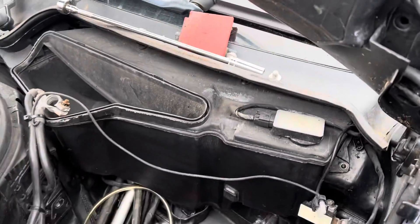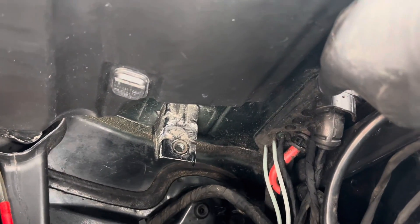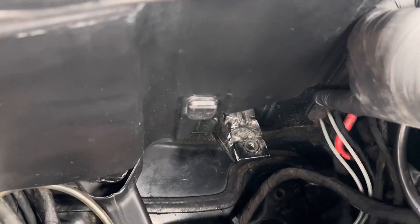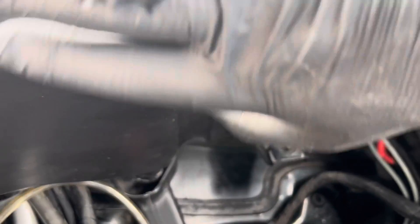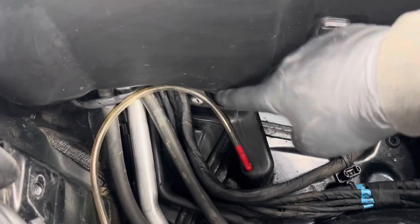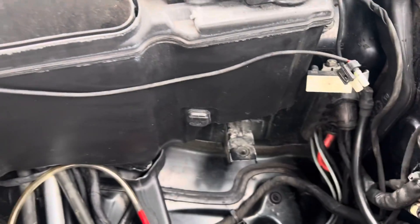Just before I put the battery tray back in and everything, I thought I'd show you the most likely cause of where the water was leaking from — this grommet here where all the cabling goes into the car. I think you can see a tide mark here. Basically the issue used to fill up to about here and then used to seep in through here, and if it didn't seep in through there it would be seeping in through where this air box goes into the cabin and onto the bulkhead. We shouldn't have any more of those issues now because the drain under here is all unblocked, this is all unblocked, and there is another further one just down in there — all clean, along with the scuttle drains that were backing up and filling over into this area.